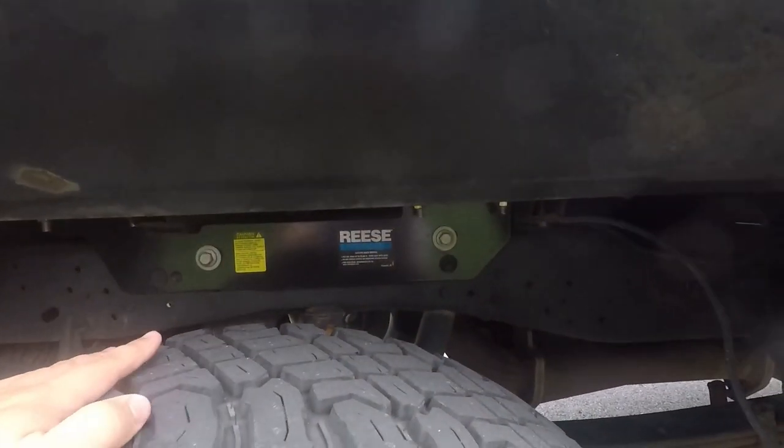Everything is all torqued and good to go. I do recommend going back after a little bit to recheck your torque on all 10 bolts — remember the two in the middle you need to get to as well. This kit is a little more expensive than the universal kits — about $100 to $150 more. I'll have affiliate links in the description for universal kits versus the specific kit for this truck. I do like the brackets — they're heavy duty — though they will get in my way a little when I do my airbags since you have to drill through the bracket.